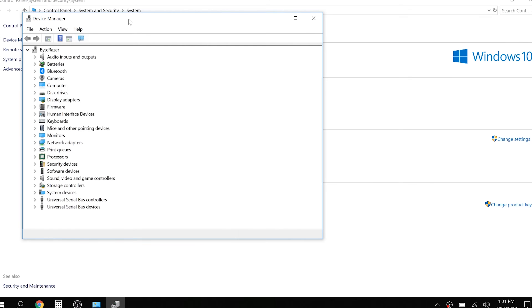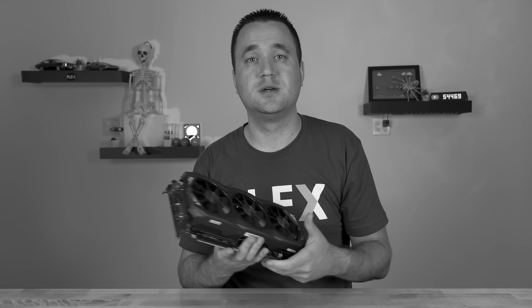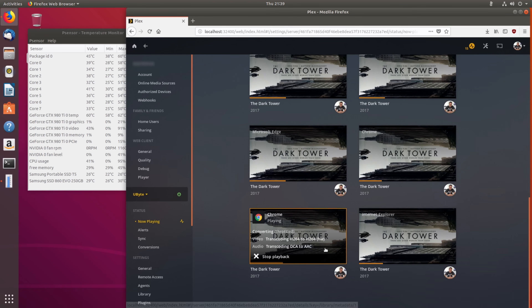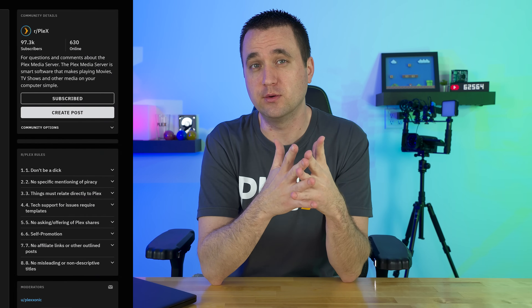What's up YouTube, Jason here with Bite My Bits. I started this out with the intent of unlocking consumer-based Nvidia GeForce graphics cards — specifically bypassing the two-stream limitation put in place by Nvidia to limit what their graphics cards can do. In my last video on this topic, I used a 980 TI with Ubuntu, applied a patch, and unlocked basically unlimited streams — 20 or 30 streams. But running Linux with the hacked Nvidia driver means hardware acceleration only halfway works: it only encodes the video and still relies on the processor for decoding. So yes, it does beef up your server considerably, but it's really only doing half of what it should be doing.